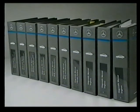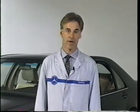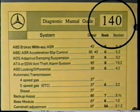This brings us to the major diagnostic reference, the diagnostic manuals. This set of manuals provides detailed testing and diagnosis for major systems and covers Mercedes models produced from the early 80s up to the present. Since this is not a one model year, one model, one manual system, finding the information needed could involve some searching until you become familiar with the manuals. But that search is made easier by this document, titled Your Reference. This was initially developed as a handout to save time when performing shop exercises during training. Let's go through an example of how this is used to locate information in the diagnostic manuals. The repair order for a 140 includes an entry that reads: right front seat does not move fore and aft. Your Reference is divided by model, so the 140 section is referred to.